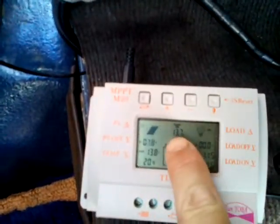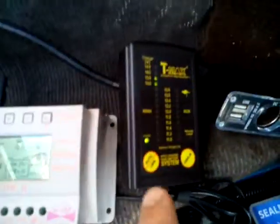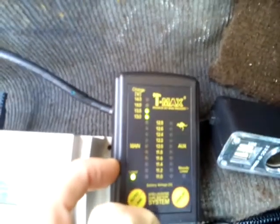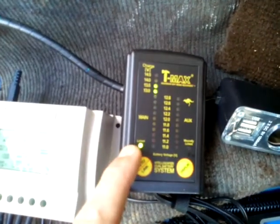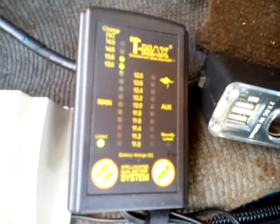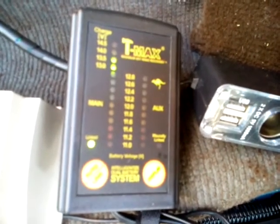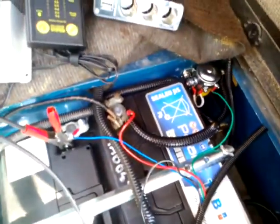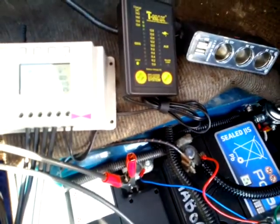At the top we've got the pulse width modulation at 13.5 volts, and that seems to tie in with the T-Max system. That voltage input into the leisure battery — I've got crocodile clips at the moment — means the solenoid is activated, joining the two batteries together for them both to charge. It looks very similar to running without a solar panel and just driving from the alternator, but of course the alternator feeds into the main battery.